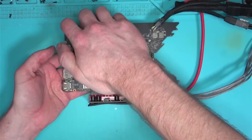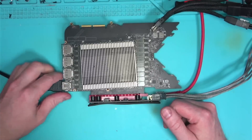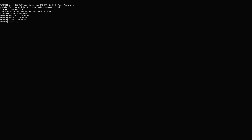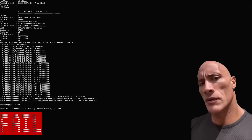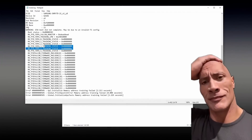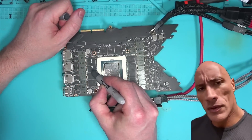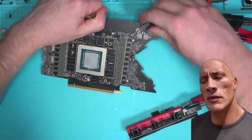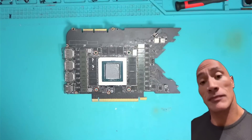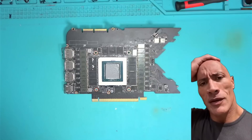With that done, it is now safe to power the card via the PC. No picture from the 3090, so let's take the HDMI cable and plug it into the motherboard instead so that we can run a memory test. The memory test has failed, and no wonder — even Windows Device Manager says we have error code 43. According to the report, we have a problem with two chips. Under normal circumstances, having two failed chips is impossible, which means the problem is not the memory. Since the owner mentioned a liquid metal spill, my guess is it dripped somewhere in this area, and that means only one thing: we need to lift the core and both of these memory chips, clean everything up, and try again.